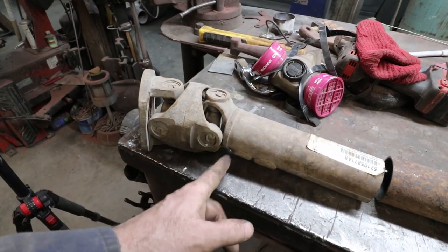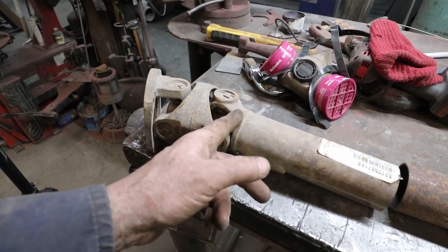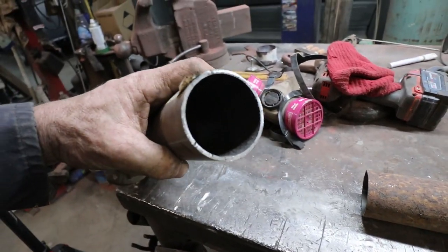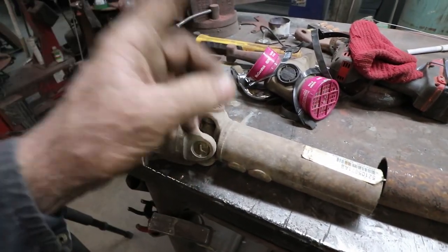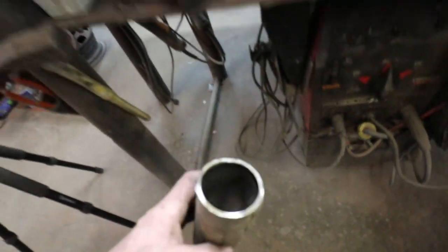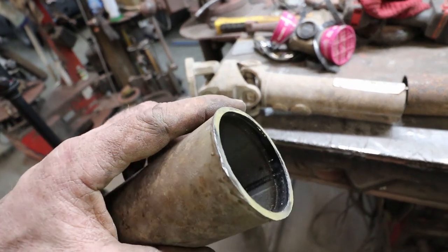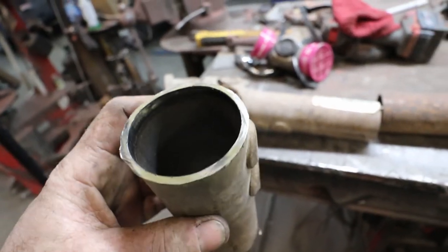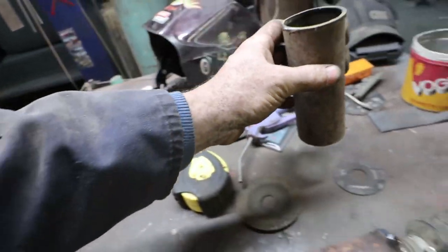So now I'm just going to cut this. I cut on the weld, just before the weld, whatever. But you only got to go through the thickness of the pipe. So don't cut to nuts. Don't cut too crazy. Like you can see, here's where the weld was, but I only went whatever I needed to get in the pipe to get the bit off.